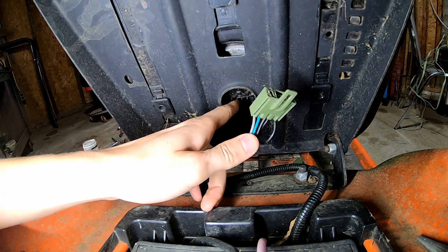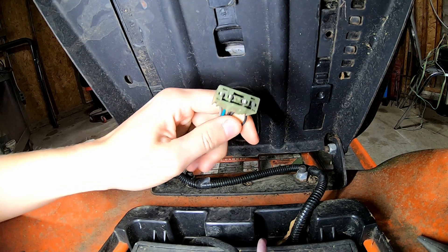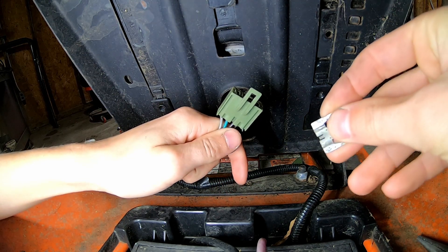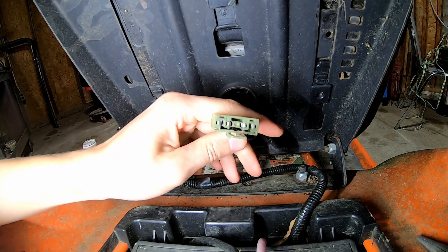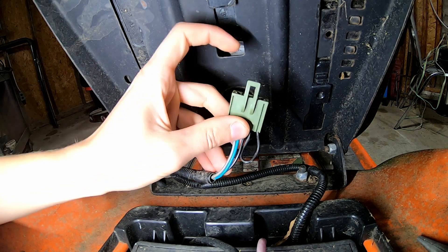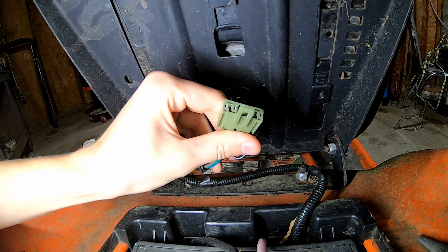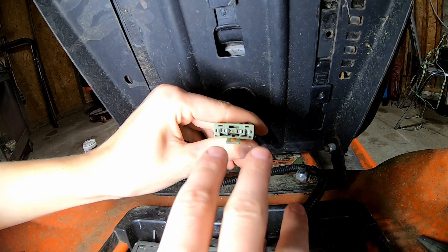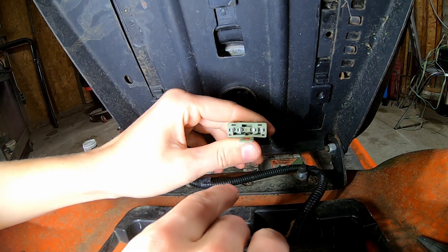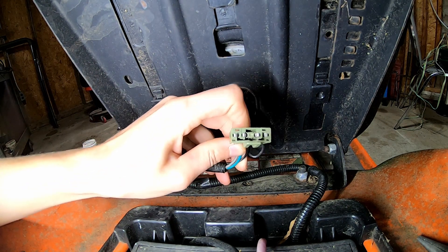Now, if you plug it back in, the seat switch would still work, so you have to leave this unplugged. You should reassemble this when you're done working on your mower so that your safeties are still active. But that covers the vast majority of these that I've seen. It's possible there may be another variation where two of the wires need to be connected, but most mowers have either a four or two-prong shorting bar — you pull that out and it should function properly. Anyway, there's a quick tip. It's pretty handy to know with these newer styles. Thanks for watching.